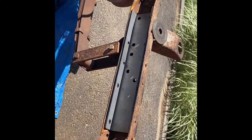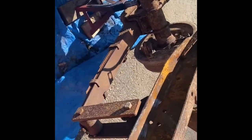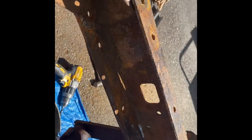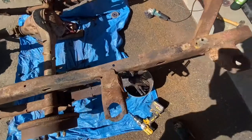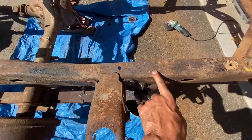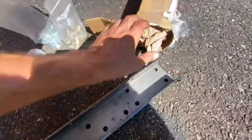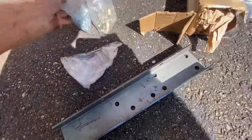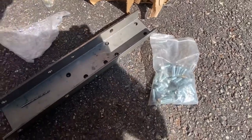I'm pretty excited to see how that goes. Got the last two rivets out. Now I'm going to clean up all this rust, neutralize it with POR's neutralizer, and probably just rattle can it and spray it. To start, I've got to ream out all these holes so it matches the nuts and bolts that were supplied with these guys — they're in imperial size, so I've got to do that first.